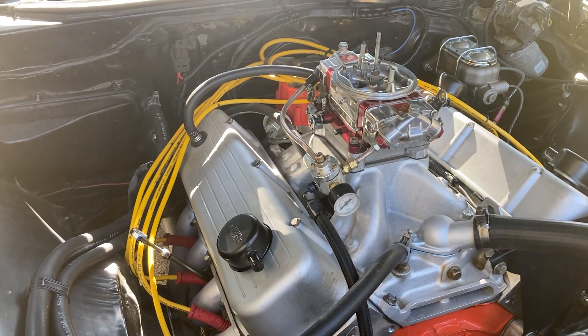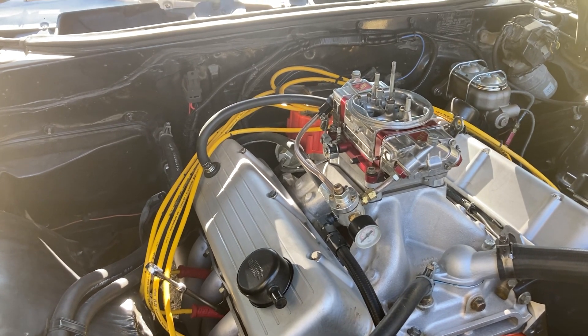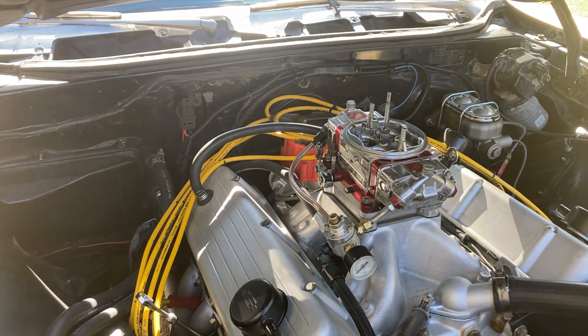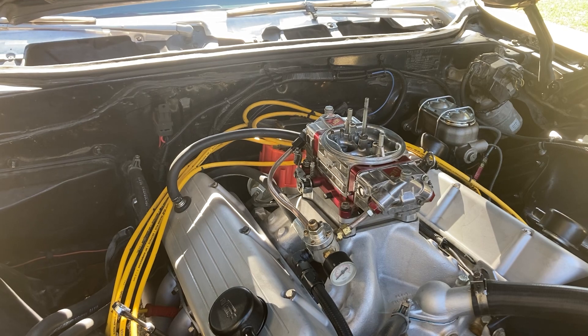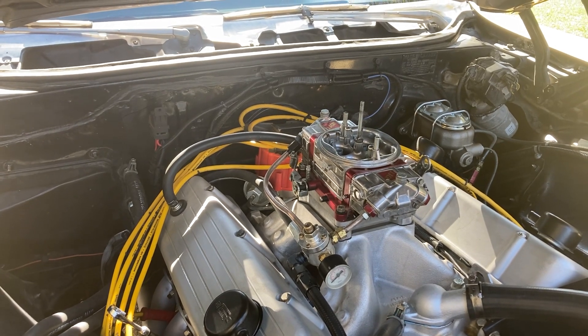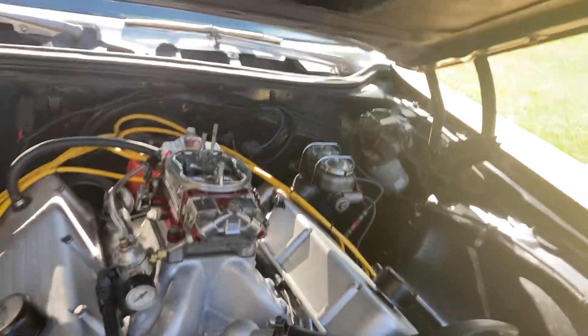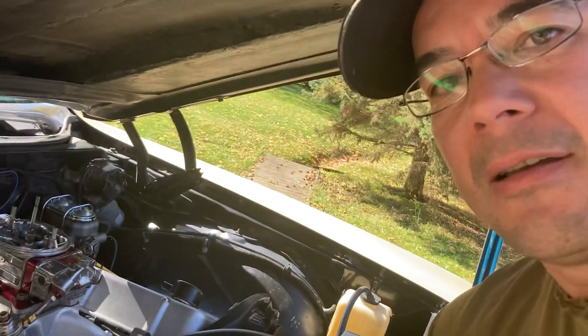I've tested it myself. I've changed it back and readjusted my idle circuit, and idle temperature goes from 160 up to 180. So if you're having some cooling or overheating possible issues at idle or light-to-light traffic, maybe just try going to full manifold vacuum.